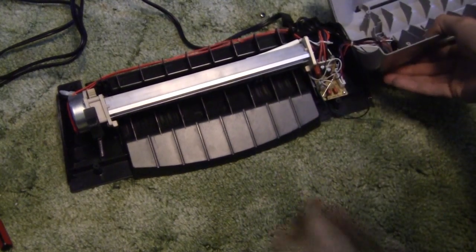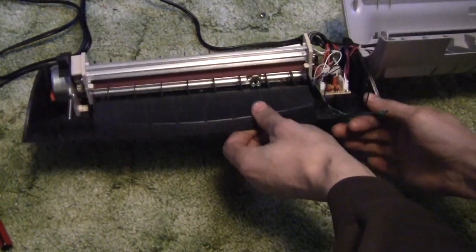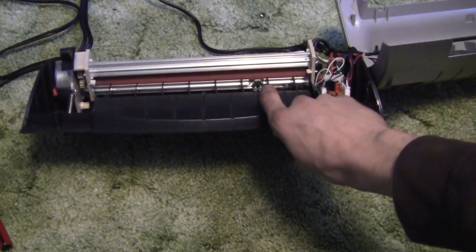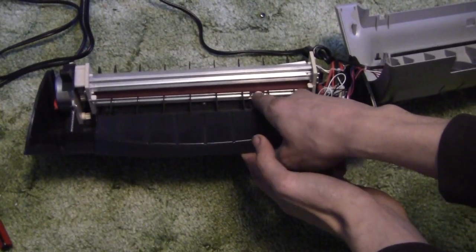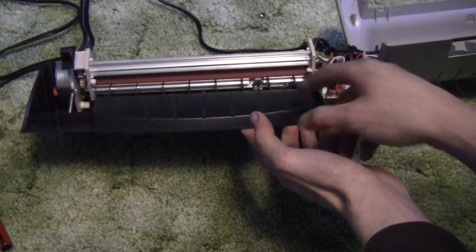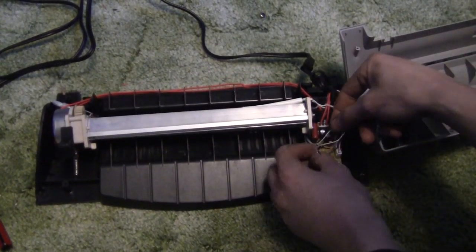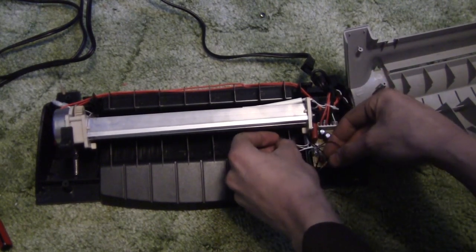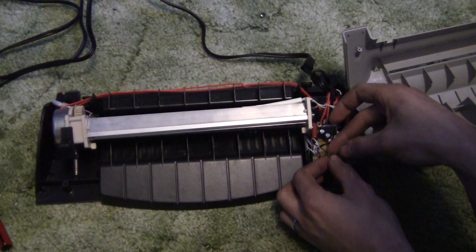You can just flop the gray side over. If you look down here — I've got pictures on the website so check there for detailed instructions — but there's a little thermistor that checks the temperature of the roller. The wires that come off that thermistor are the two black wires in this bundle.